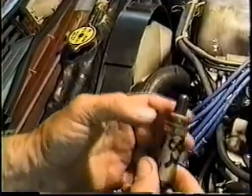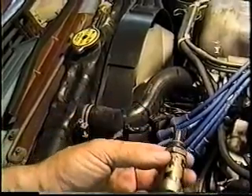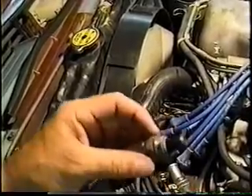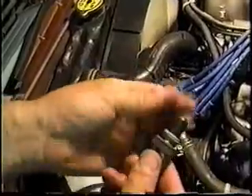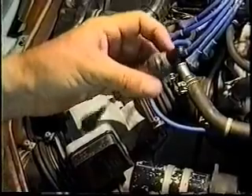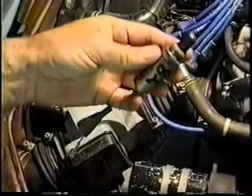It's always important to put a little anti-seize compound if you have some. All the new ones will come equipped with some anti-seize compound to keep this from frying and embedding itself permanently in the exhaust manifold. This little connector here was defective because it had run rich — it had been cleaned off, but it was really black. It had run so rich for so long that it just no longer sensed anything, and I saved it simply to show what one looks like.